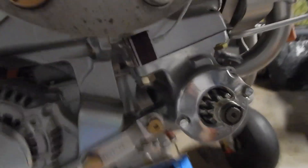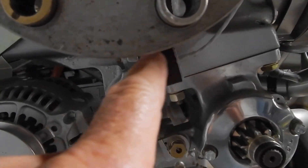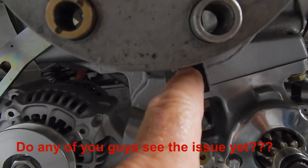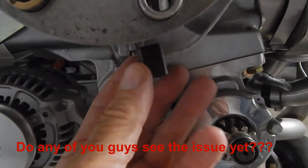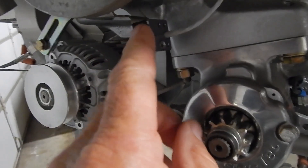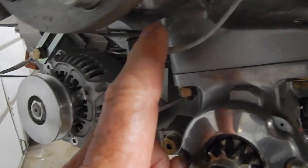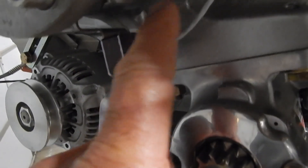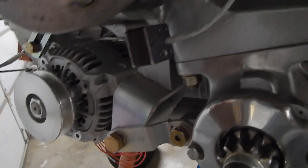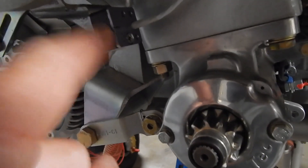We get the voltage drop for channel two but not for channel one — and the same issue with the spark. It's my lower sensor that's the problem; my upper one is working fine and setting these coils. I'm getting spark on that set of coils fine. On the lower sensor, I'm only getting spark on my outboard coil. I adjusted the gap as Klaus recommended — I moved it all the way from 0.020 forward through 0.030 all the way back to 0.060 — and the top sensor reads and gives spark every single time regardless of gap.